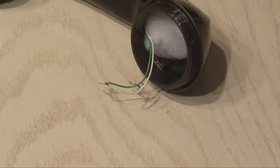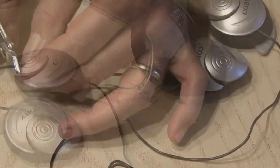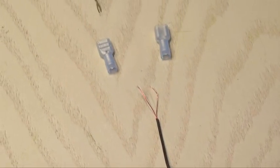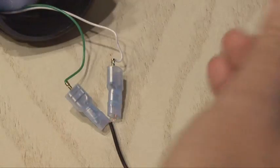The idea is to replace the earpiece, so I've got an old set of headphones that had a broken connector on them. I'm going to use those and take one and snip the wire about three inches from the speaker, and then completely take apart the housing for this speaker, the plastic and the foam earpiece, which will leave me just with a bare speaker and wire. We'll attach a couple of insulated spade lugs to the two wires on the speaker, and then that will go to the two wires that are left in the earpiece in the phone.